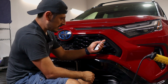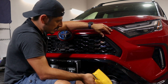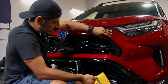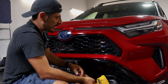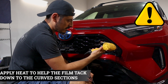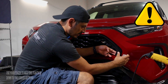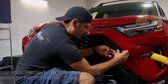For the next section, you are going to need to apply heat so the film loses tension and is able to tack down on the curve. If you just apply it without heat, the film will come back to its original form. Apply a little bit of heat to tack it down on both curves. You can hold it — just be careful not to burn your fingers — let it cool off, and then use your finger to help it form to the curve of the grill.